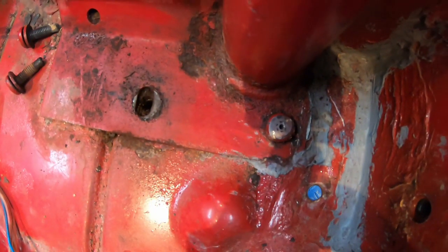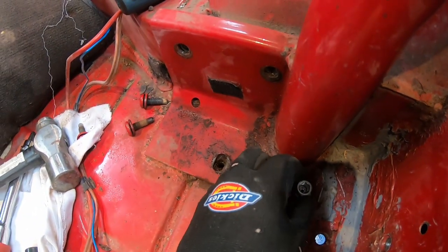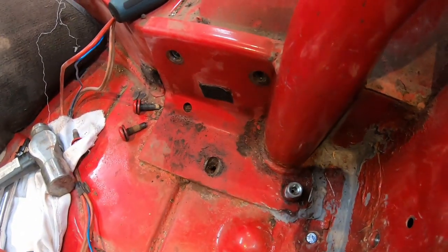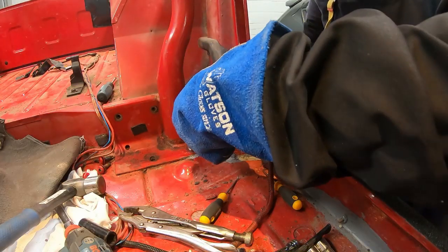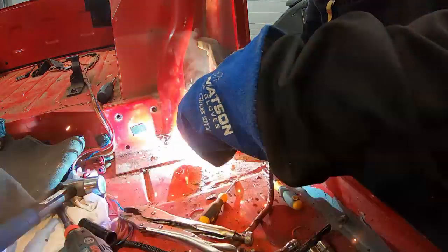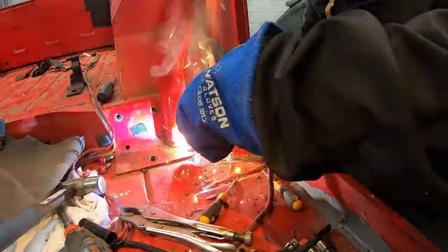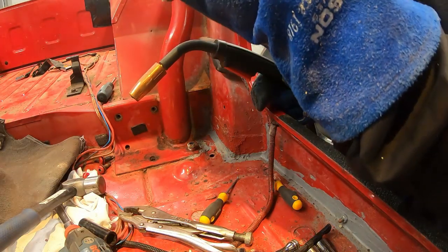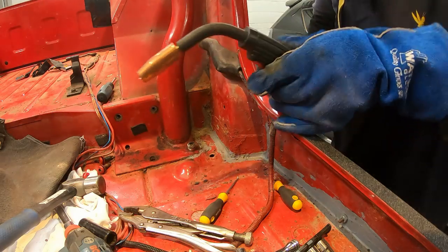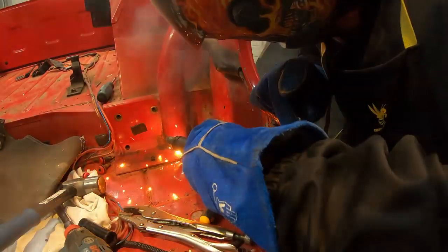Here's one where my bit broke off. I was using a safety Torx with the hole in the middle — don't do that, they break easier. I had to weld a nut onto this one to get it off. Although it looks like I just put it together and it worked, I actually tried this about six or seven times. In the end, when it came off, I twisted the entire head off the bolt anyway — so even though the nut finally stuck, it broke the bolt regardless. There's a lot of rust underneath on this side.